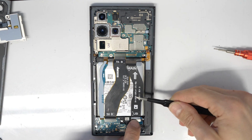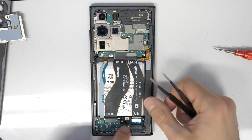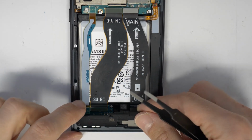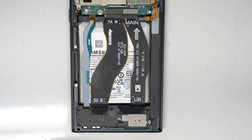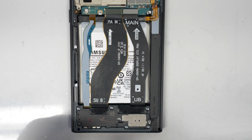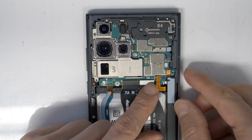And then the last one. First to the bottom motherboard, to the antenna, and then to the top motherboard as well. Let's take the protection plastic with the speaker here, push it inside the frame, and let's mount it with the screws. Let's proceed with the top and connect your battery to the motherboard here.